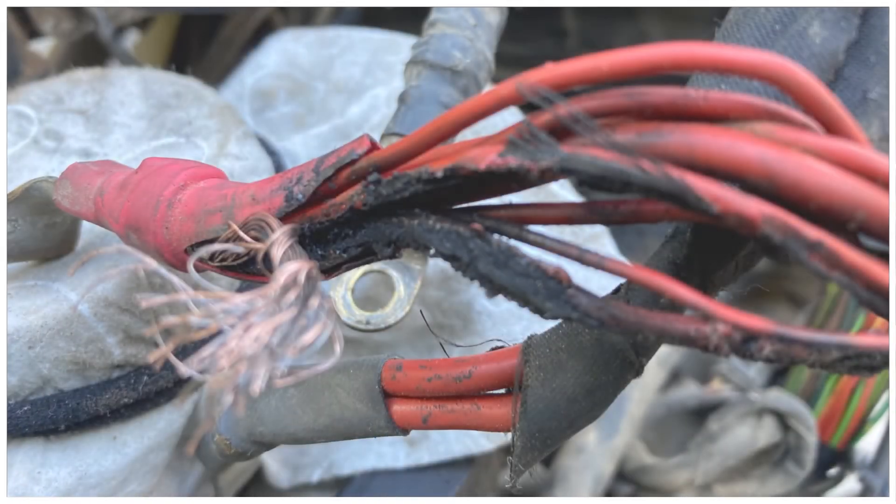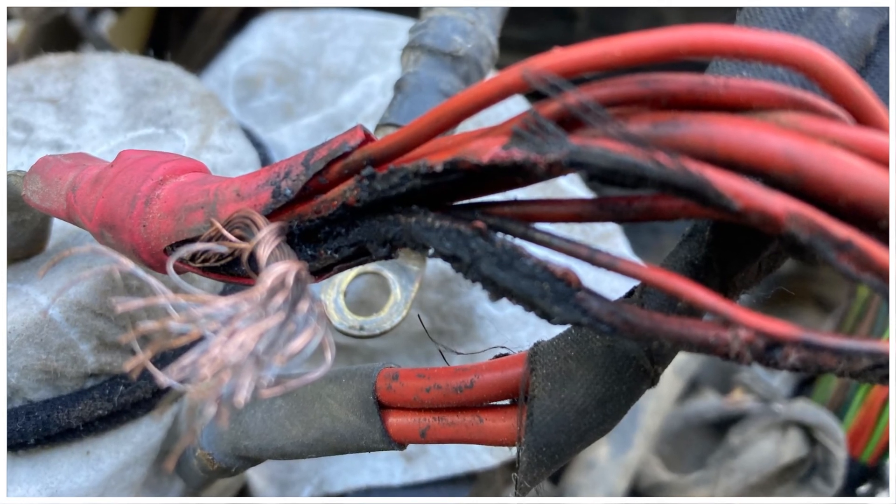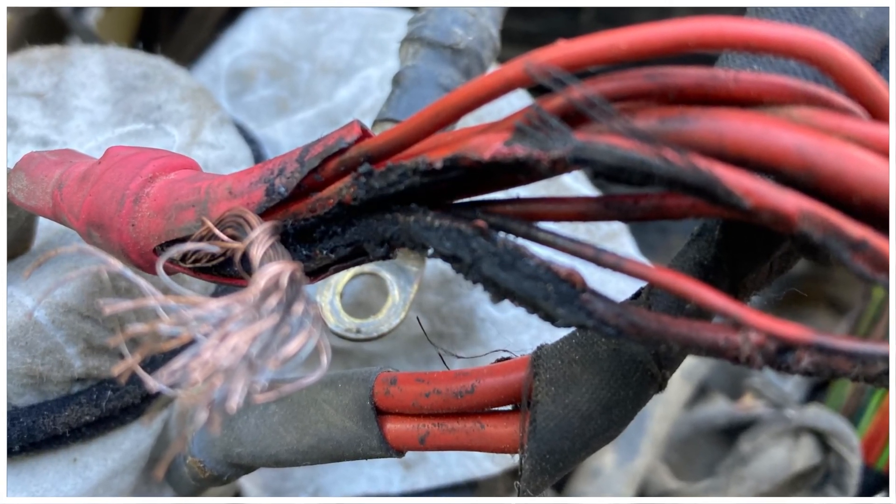Busy day today — we're here at Motocamp Bulgaria where our motorcycle is stranded. It's stranded because we had a wire loom catch fire. Basically, a large section of 10-gauge wire between the positive lead and the ABS computer shorted on the frame and ended up catching fire and burning a lot of our wire loom. We're going to go through the process of removing the old loom and putting in a new loom.